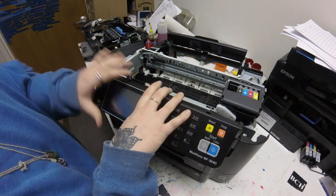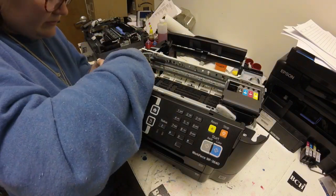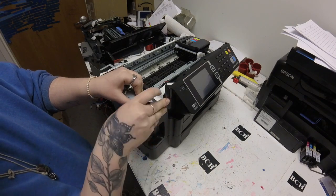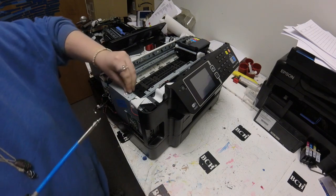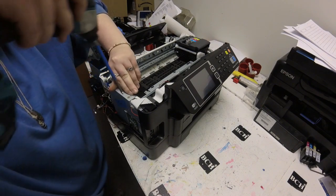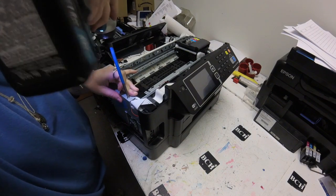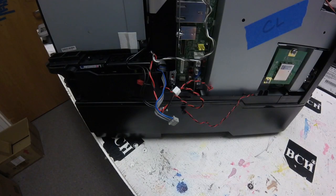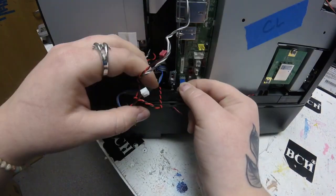We're going to sit our LCD panel back on nicely, then work on putting our FFC cable back in place and connecting our wire. Then we're going to go ahead and screw down the ground wire onto the top of the mainboard. This is the screw most people forget — they end up with one single black wire and don't know where it goes. If you see a single black wire, normally it's a ground wire, and you can just ground it. Now take a look at your pictures on the flow sheet, and Abby is going to show you how to plug everything back.